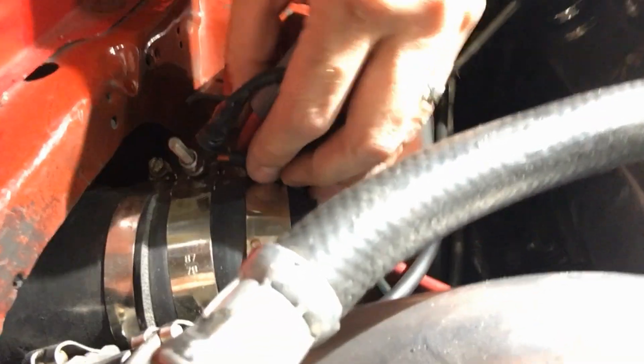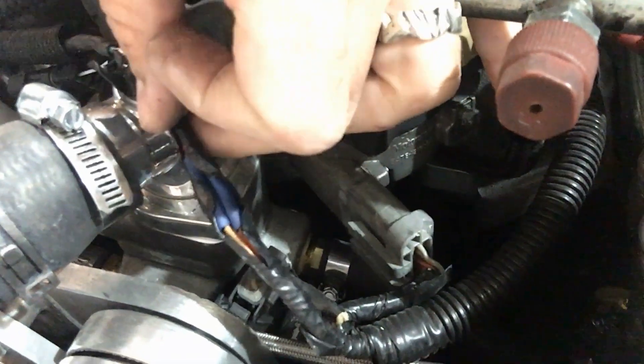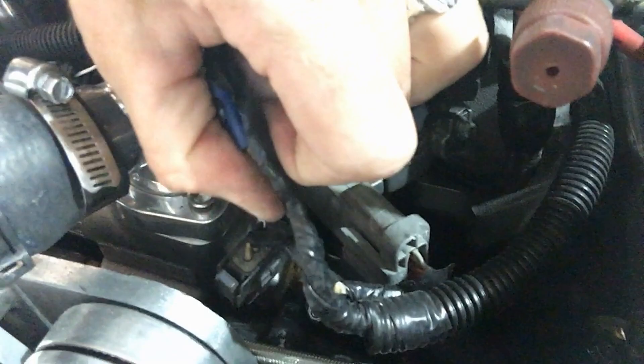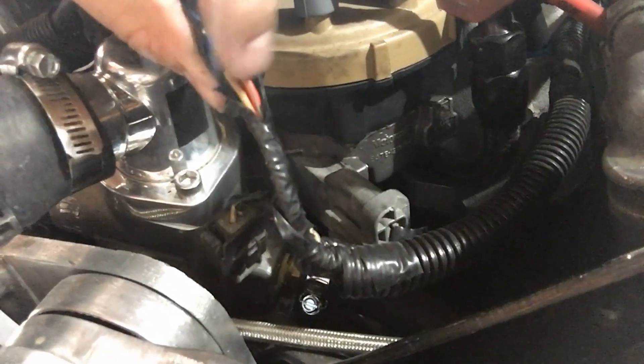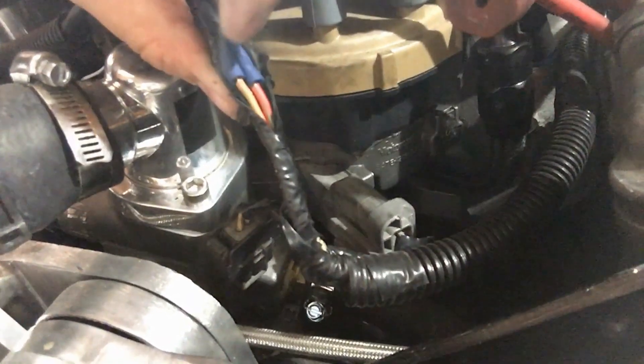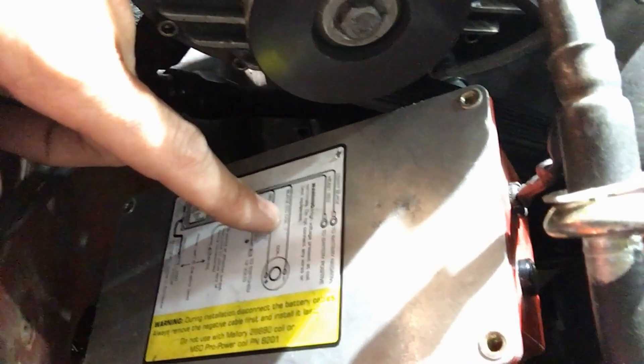You can see how I've got mine here — my orange and black wires wired into the coil, coming from the MSD box. Over here I've got this wired — this is your red and white coming from the TFI module, and you can see the red and tan I've got coming from the distributor. The coil used to sit right here. So tap off your red and your tan, which is your negative signal that normally comes from the distributor to the coil, and that goes into the MSD box on the red and the white. Then your coil is black and orange.